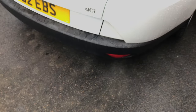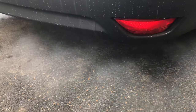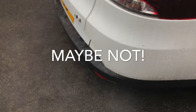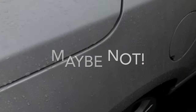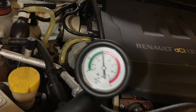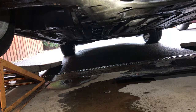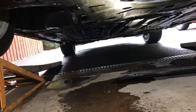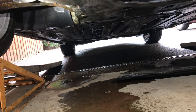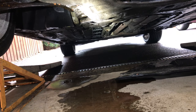What are you, a wee rev? Aye. Definitely. That's a lot, eh? Well there's a nice sight — it's good and bad. We've got a leak, and they shouldn't be — they said they put a new water pump on it, so it's probably coming from there. So we've got no call on the head gasket yet. We'll wait and see anyway.